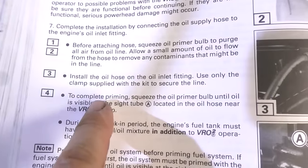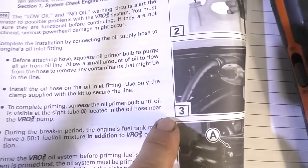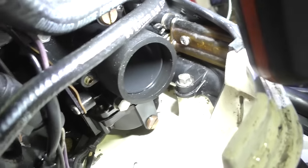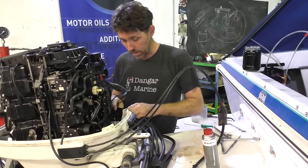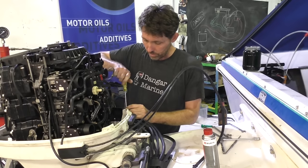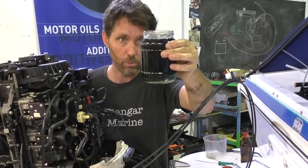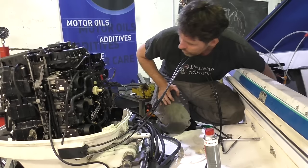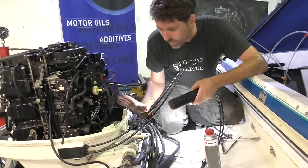Here's what the manual says — it was actually directly above what I was looking at before. To complete the priming, squeeze the bulb until oil is visible in the sight tube, which is here. If you look on the outside of the cowling over where the oil comes in, the tube just inside the cowling is actually clear. So the idea is you prime it until you can see oil there, and then you stop. It also says to use real hose clamps for all the oil lines, not cable ties or whatever. So I'm just putting a new hose clamp on this hose where it comes into the motor. This fuel has been sitting for quite a while now and hasn't separated into a water layer, so I'm going to do one more jar just because I'm paranoid, and then I think we'll call the fuel good. Hose clamps on. I can already see oil in the clear section after a single pump, which doesn't surprise me because we've already primed to the end of the line — so that's good to leave now.